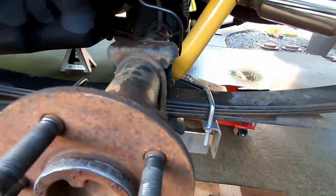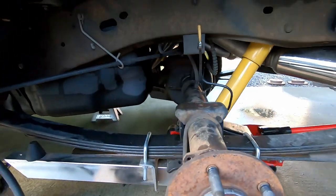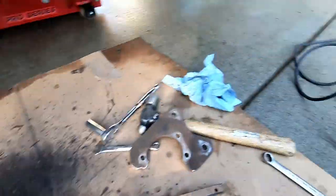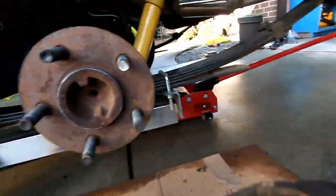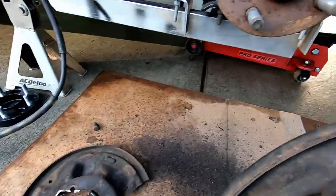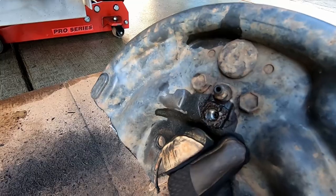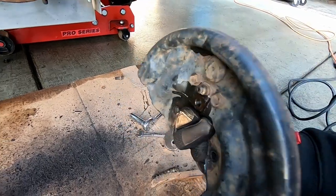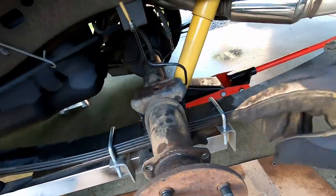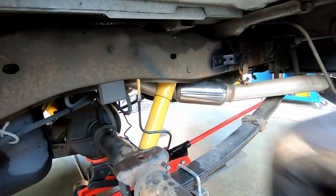I've run into some things on the left side that I want everyone to be able to see. All the old drum brake shoes, springs, and associated hardware — I literally just took the angle grinder, cut all the springs, and ripped the shoes off. After that I went to get the fitting out of the wheel cylinder, because you need to get that broke loose before you take the backing plate off the axle. I had to torch the wheel cylinder, and then the nut came right loose.